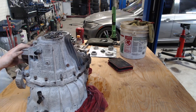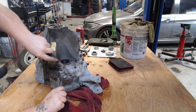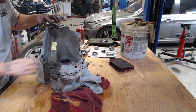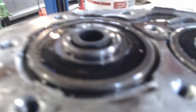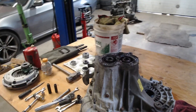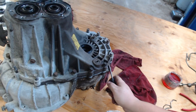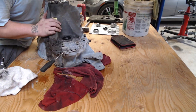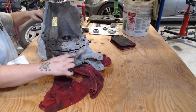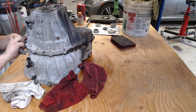You'll need to remove the snap rings that hold the bearings in place in the case to keep them from walking. You might need to smack the case side with a mallet or dead blow to get it loose from the RTV. Here is the video of the input shaft or main shaft bearing play — you can see prying from the opposite end where they provide a groove to separate the case halves. That is way too much play.